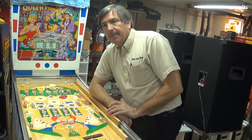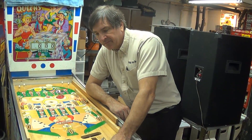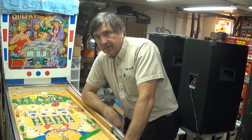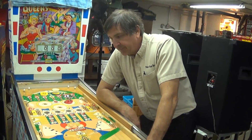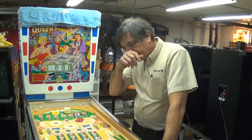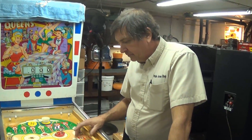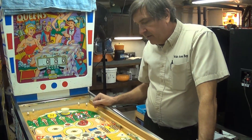Remember that Guns N' Roses pin we had? There was a fairly famous operator — Pinball Pete — who varathaned every cabinet that came in. Mixed opinions on it: the cabinet looked great, you could hit it with a ball peen hammer and it wouldn't dent, very durable. But it yellowed — no more white in the artwork. Varnish will yellow clear; you can't control it.